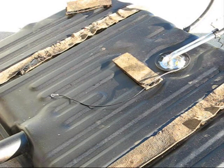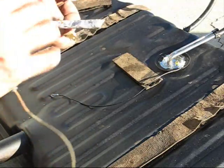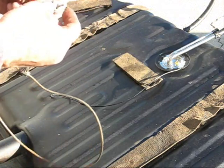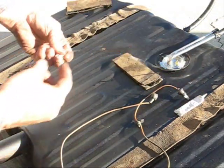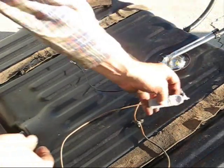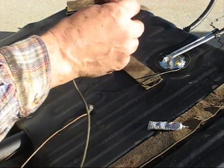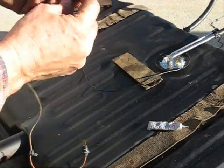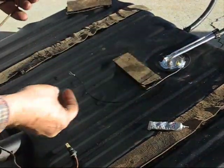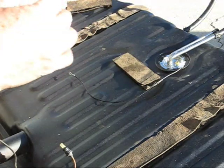There's one more thing you might want to do — here is the cable that hooks up the gas gauge. I use this dielectric tune-up grease I got a long time ago. I'm going to put just a little bit on this ground connection because that goes to the body. I'm going to put a little bit more where this connector connects up to the gas gauge wire, and also right here where it connects up to the sending unit. Grease those up a little bit because they're going to be exposed to the elements — it may help a little bit with conductivity.